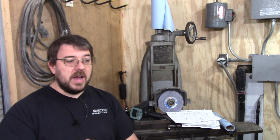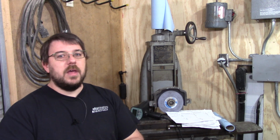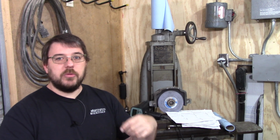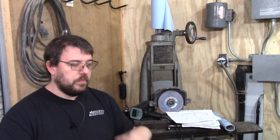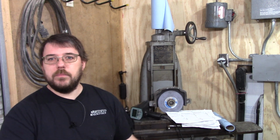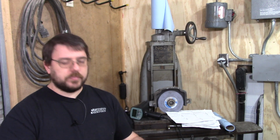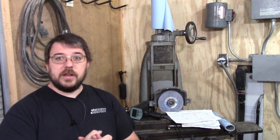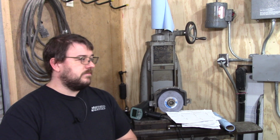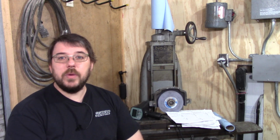And keep in mind, with the 2AR, again, with an almost identical valve train, I had a much lighter valve spring, and I was able to go to 8,500 RPM. Now, I want to say safely and in a durable way, but the truth is I haven't actually put a ton of miles on it. So we need to take that with a grain of salt. Maybe the spring that I used is not adequate, but I like data. So how do we get real data on that?